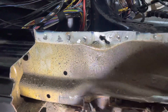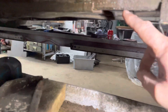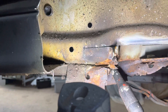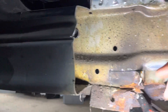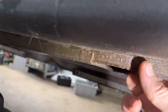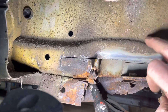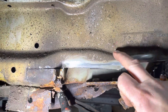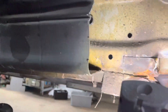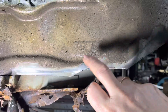I'll continue the line from below — I can just see it here. This line under the whole car is where the car bottom comes from at the bottom and goes to the side wall structure and then to the outer sill. Down here we have three layers of metal that are spot welded together, giving a really strong structure. This middle section is 1.2 mm sheet metal, and the others are 0.9 or 1 mm.